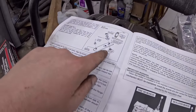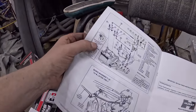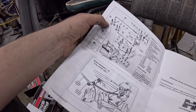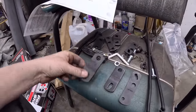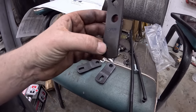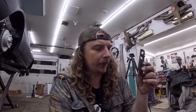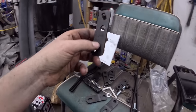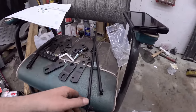It tells you how you should put your arms on — this is the big difference. I didn't know this, but pre-69 it's got a stud on it and post it you put a bolt in. It tells you what way the arms should go. By the looks of it we'll be doing this one out — this one goes into the transmission and this is the reverse. And by the looks at the bottom here, for some models, it's got like a little lockout — you've got to put it in reverse or something like that. But what we can probably use it for is backup lights. They'll have a little rod into a micro switch — as it goes in reverse the lever will move and trigger it.